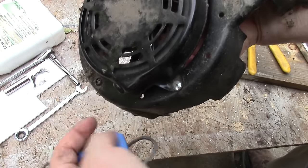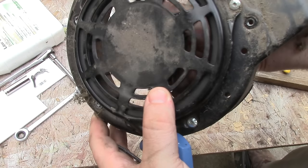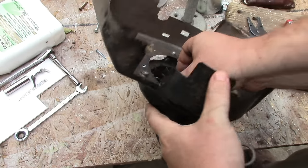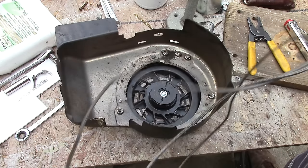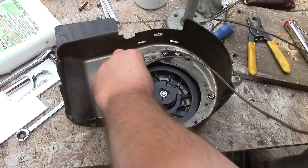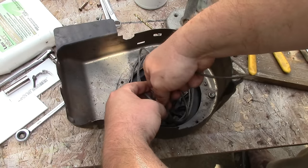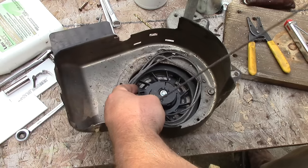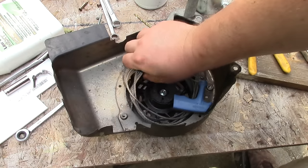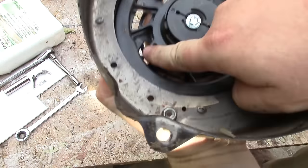Here is the end that broke off. If you pull the rope out this way, that means that tightening the spring is clockwise and it'll recoil on its own. The way I estimate how many turns I need is I take the rope I want to install and I just guess — there's one, two, three, four, five turns.